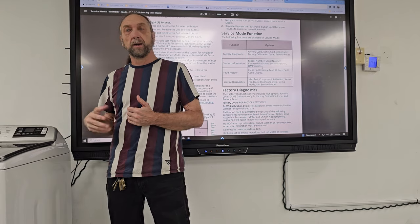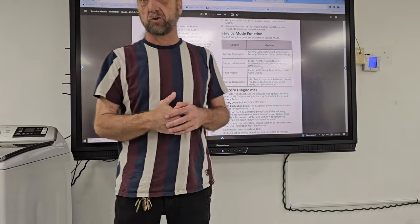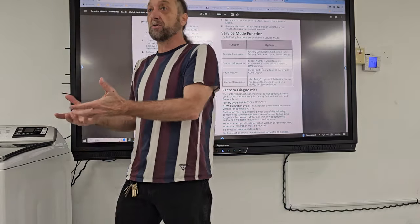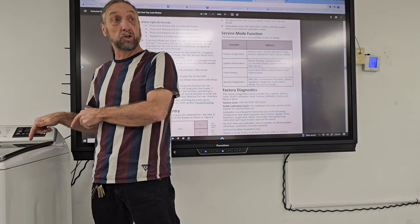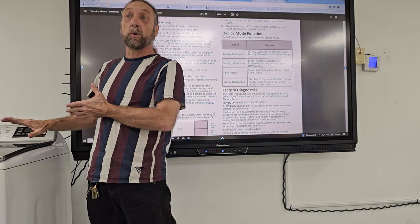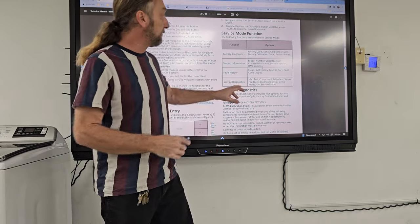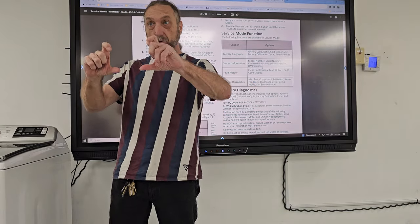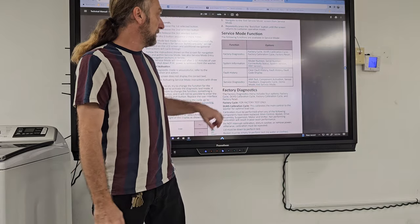you found in there, clear them, and then run the machine through this diagnostic or troubleshooting and see if the fault returns. Because if the fault returns and comes back, then we know for sure that's a problem that's still existing in the machine. Because if we cleared it and it's already been repaired, it should not return. Okay? So clearing that fault history, we don't clear it right away, we make note of them, take a picture with your phone, write them down, and then we see if those faults return.